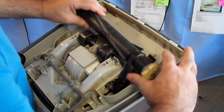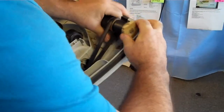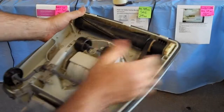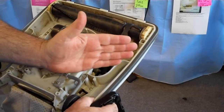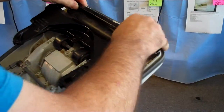After we get that on, the roller brush here — you just stretch that guy back on. Then, like any other vacuum cleaner as shown on my other videos, turn the belt by hand first. That way, if the belt is kind of kinked and you turn the vacuum cleaner on, a lot of times the belt will burn off on you. So you definitely don't want to do that.